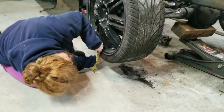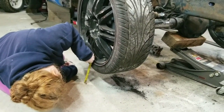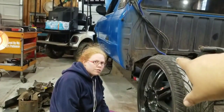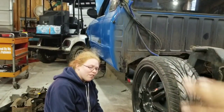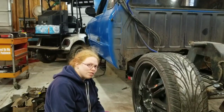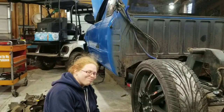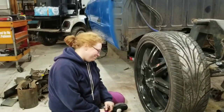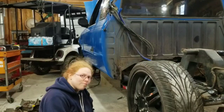You've got to find the closest spot to the ground — actually lay down and look at it. It's about 5 and a half inches to the lowest point where the curve of the tire goes down. So we're going to take the 16 inches and subtract the 5 and a half — that would be 10 and a half inches. So this will have 10 and a half inches of lift off the ground with the way the bags are set up now.